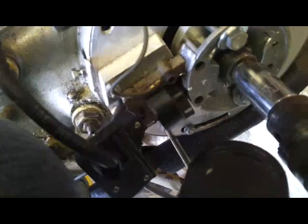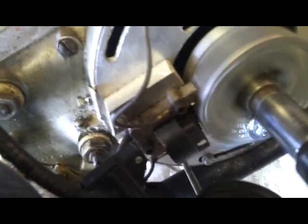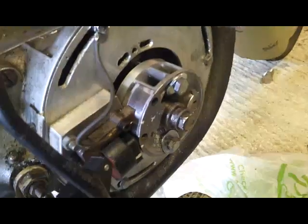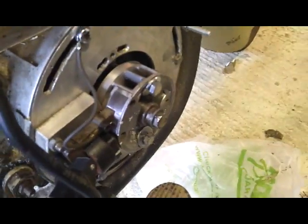So I'm going to bring in the strobe here and try and do all this one-handed, which is not going to be easy. Get the strobe down in there, bring in the drill on the other hand — it's going to make a bit of noise. It just shows it does spark a treat and the timing is spot on at 5 millimetres BTDC.